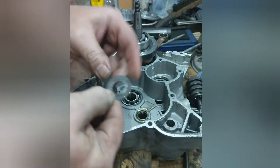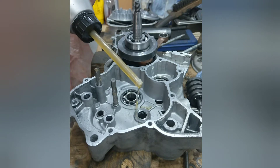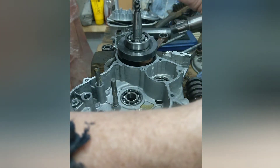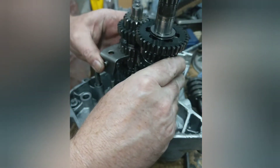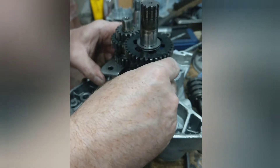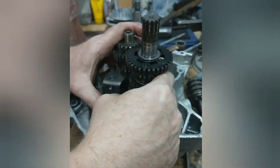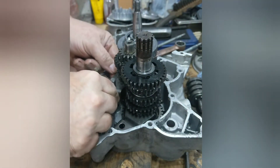You've got that shim — put that shim in, another spot of oil. There's a wee bit of technique in getting these gears in. Put a couple of selector forks on the gears. Then you want to enter that one onto that shaft — this can be a wee bit fiddly. Just make sure that shim underneath doesn't move. Get that entered on gently. Just make sure that shim's alright — that's still in place. Get that sat on.